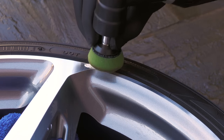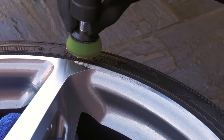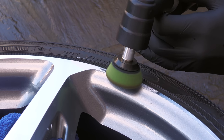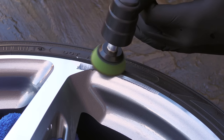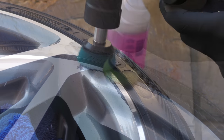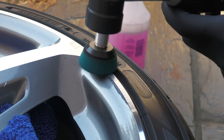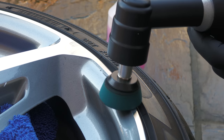My mini MP9 machine in rotary configuration was used in conjunction with some moderately abrasive paintwork polish to remove any light marks and brighten the surface up. While this will leave a polished finish that won't match perfectly with the surrounding factory diamond cut, it'll only really be noticeable at certain angles and in certain light — but would still look far more presentable than a rough, unaddressed scuff.